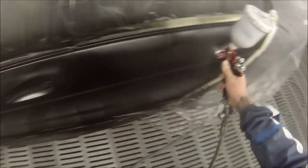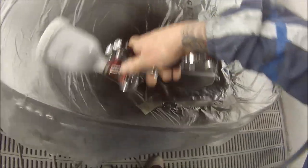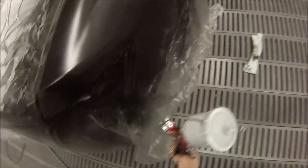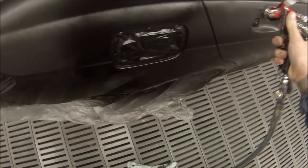It's actually exactly the same colour as the Australian Holden Commodore's Phantom Mica. I've found that sometimes if you get one of those Phantom Micas and you're trying to colour match it with Standox, you're actually better off mixing up this colour — which is called Obsidian Swartz or Obsidian Black, code 197. I've found this colour actually looks better on Holden Commodores than the actual Holden Commodore colour does. Bit of a tip there for any Aussie painters using Standox solvent base.